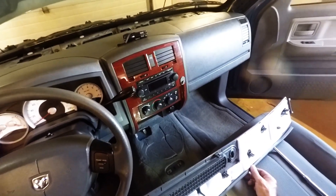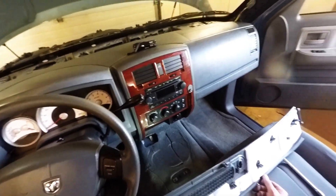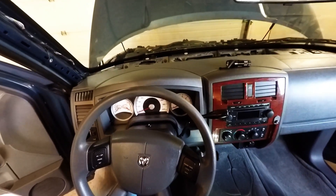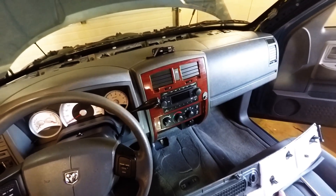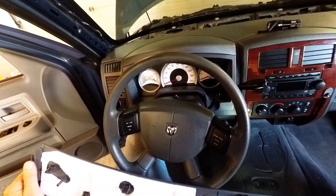As for the console, it was 8mm bolts — I think there were five of them to get the console out. As for the rest of the dash, you have to drop the steering wheel down; there's four bolts there, and then you have to take a few other items off. I'll go through that on the rest of the video once I start getting them off.